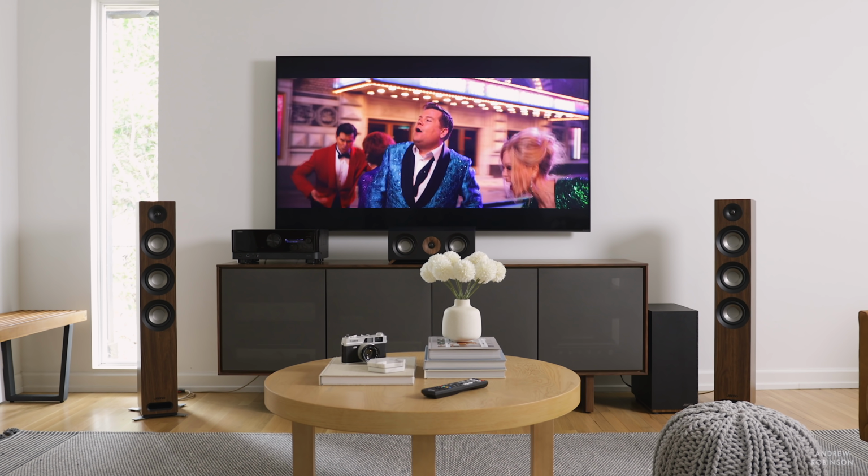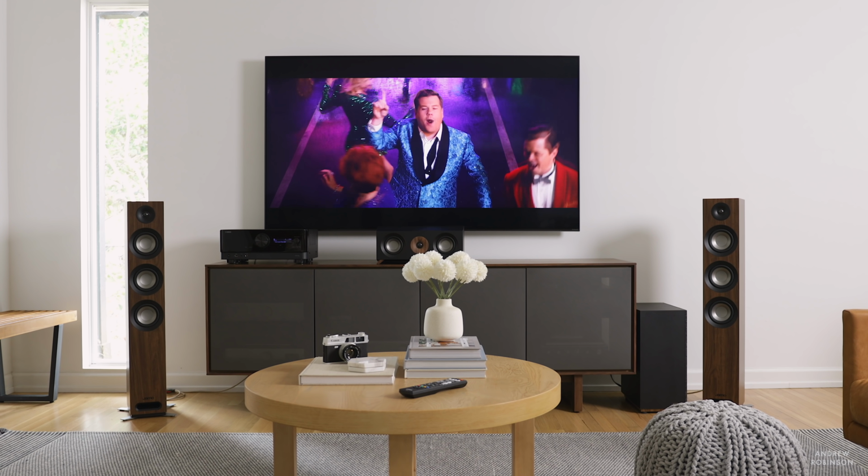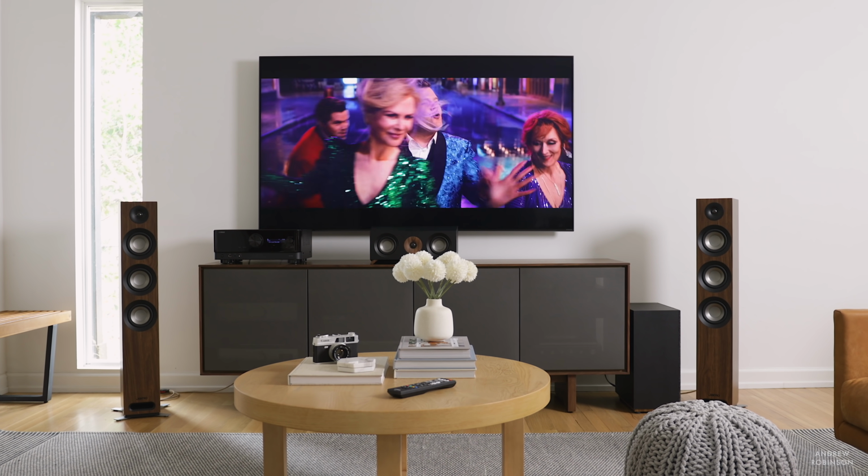And it also means that it has to have finer control over its backlighting, and this is where local dimming zones come in. Without getting too technical, HDR content has a greater range between light and dark. And in some instances, HDR content is dictating the amount of light needed based on the image that it is displaying on screen. So rather than turn all of your backlighting on full, some of the backlights or zones get dimmed down while others get maxed out. And this is essentially what local dimming is doing.